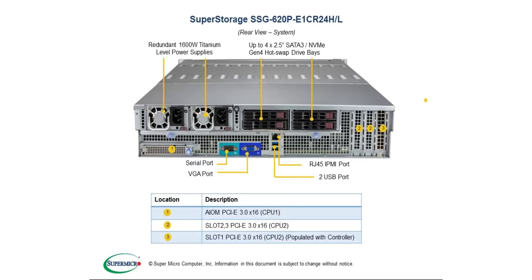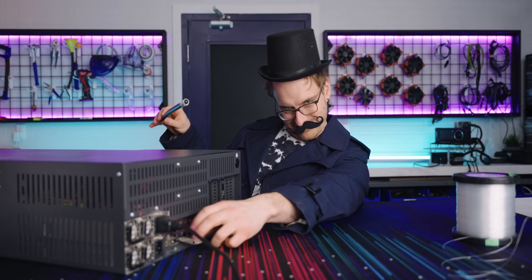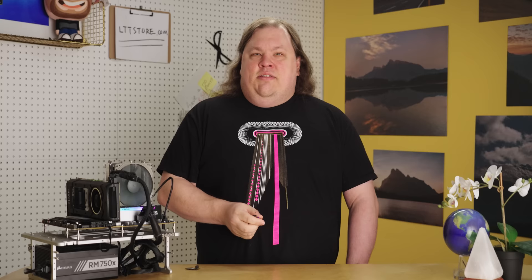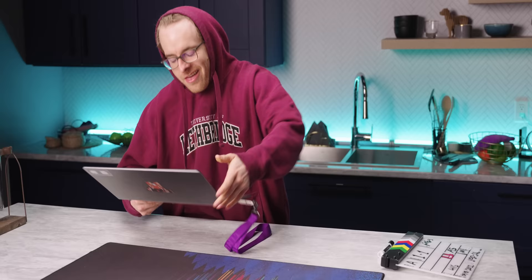But why not just use any USB drive? Servers have USB ports, right? Well, they do, but generally servers don't bother with more than two USB ports so you can plug in a keyboard and mouse. The real issues are reliability and security. The second-to-last thing you want is for someone to snag their sweater on the boot drive of a mission-critical machine, ripping it out. And the last thing you want is a ne'er-do-well swiping it, inserting some malicious code, and plugging it back in. Another reason USB drives suck for this purpose is they tend to be made out of the absolute worst NAND manufacturers can find. It runs slowly, it's prone to errors, and generally has a very limited lifespan. This is fine for those cheapo random USB keys you get during college orientation week, but when you need to do real work, they're dangerous to rely on.